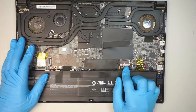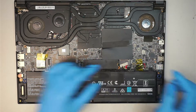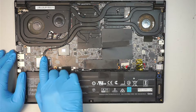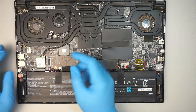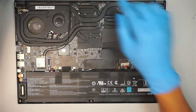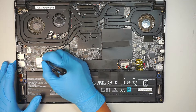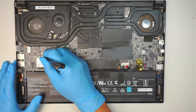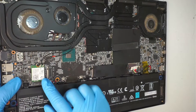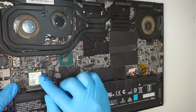The next step is to disconnect the battery. You want to slide the connector down towards your body. Then go ahead and disconnect the Wi-Fi cables. Because both cables are black, it can be hard to identify them. For my case, I have a little red dot — the red stays on the right. If you have a Sharpie or pen, make a mark so you know which cable goes left or right. Just pull the cable straight up.